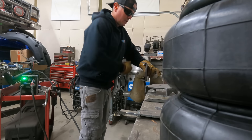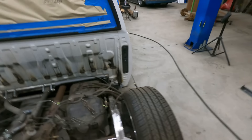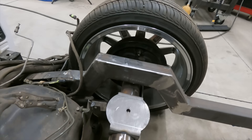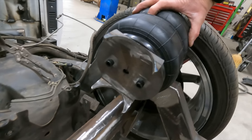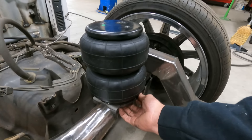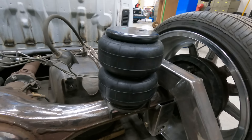Piece of cake. Let's go see if that fits the axle even before I grind it — these things always take a little sanding to get perfect, but you can always see how close we are. That's going to be good, fits nice and tight. I'll probably even be able to rosette weld the center of it. Let's trim up the other one to match, sand them, and move on. It's pretty close to the axle tube so I have to use a short Allen head bolt. Another trick when there's very little space is to use header bolts because they always have a really small head. Now I think we can figure out what we need for cross members in order to get our height right and give us clearance for the bags.